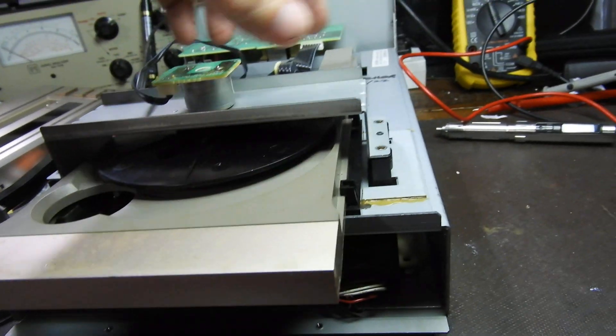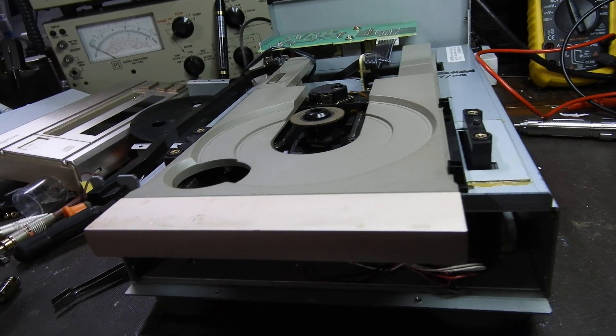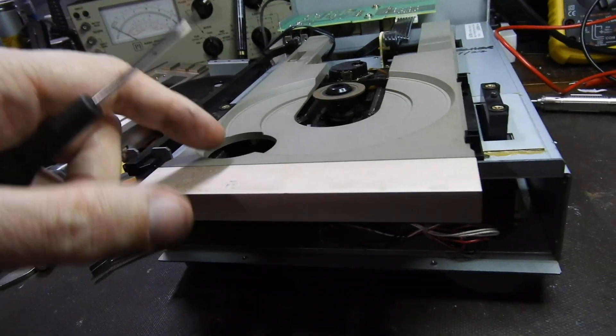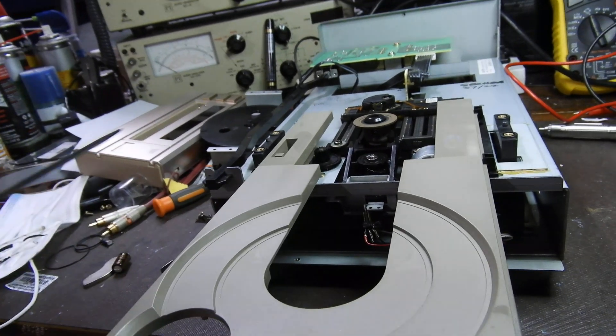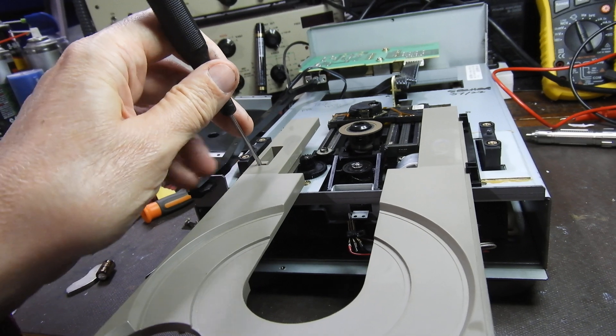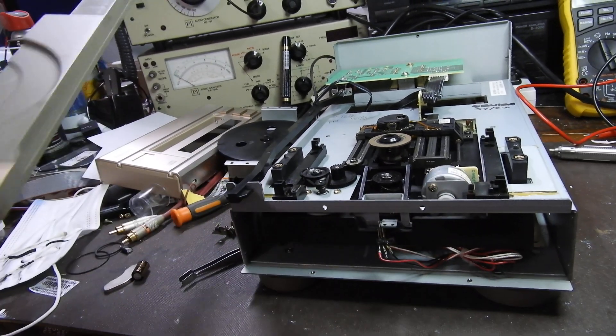Next, two screws each way to remove the bridge — same procedure on the P700. The next stage is to remove the tray. The tray simply slides out until the point where the catch needs to be disengaged. Just lift it up a bit and it comes out.